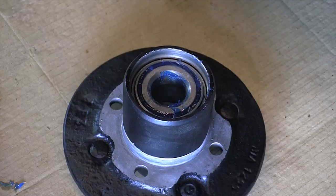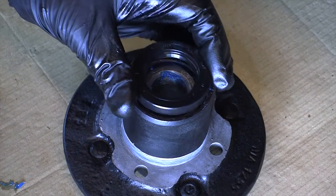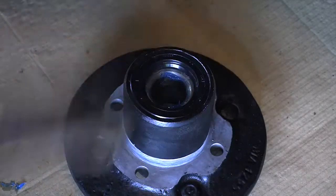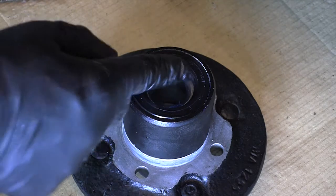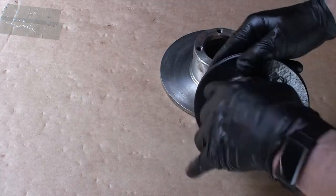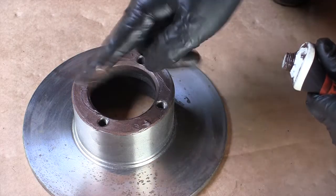One packed bearing. I can't find my rubber mallet so I'll be careful with a standard hammer — get it started and protect it with cardboard. I'm just going to put a little smear of grease on the seal to help it go on the hub. Before we go too far I'm going to fit the brake disc before that gets forgotten, because it's not like a modern car where you can put the brake disc on after you've put the hub on. I'm going to put some copper grease around the interfaces between that and the hub so they don't stick on like it did when I tried to take it apart.